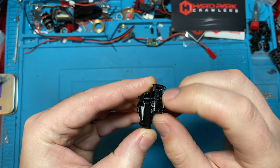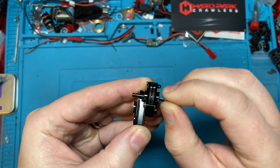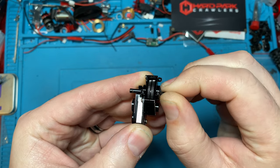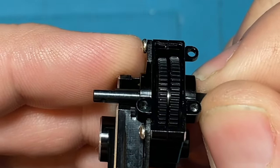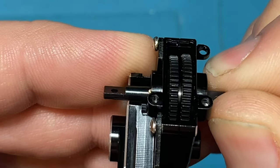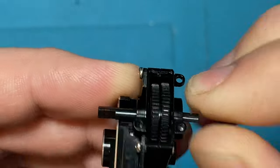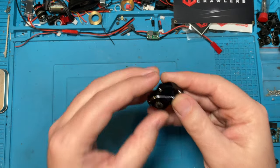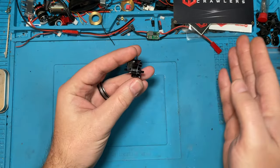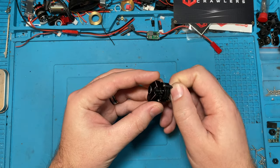There are two different gears and they spin at different rates. The one on the left here spins just ever so slightly faster — so that's really cool. One of the things you have to be careful with is the direction you mount it. You want to make sure it's mounted in the correct direction, otherwise you overdrive your rears and that's not necessarily what you want.